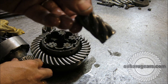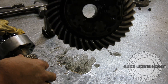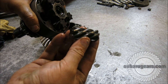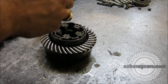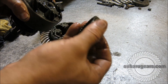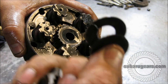This was previously unopened. We opened it to inspect it, put it back together, and then installed it in the transmission. We didn't make any modifications to the housing — no cleaning up, deburring or anything. The worm gears on the other side were all very good as well — no sharp edges or break-offs on any of them. We take out the center; there are Belleville washers in the center, and we did notice that these washers have become squashed and difficult to move. As we remove a couple of these washers, you'll see there is a crack that's developed in one of them. Certainly we would recommend fitting upgraded washers to these limited slip differentials before installing them in your car.